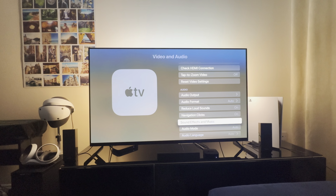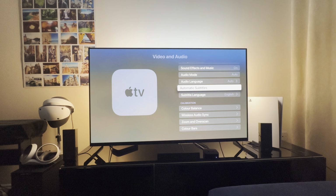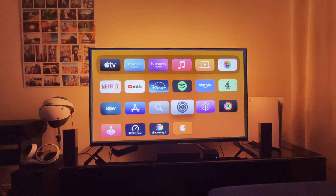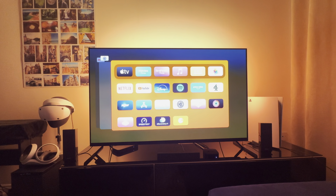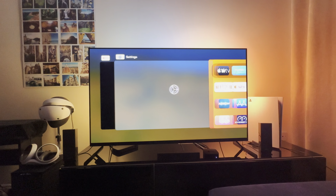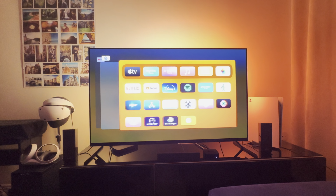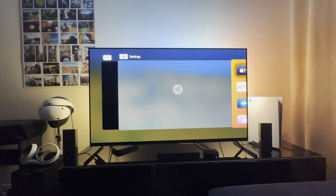Now, there are other light strips available on the market which claim to be compatible with HDMI 2.1, but when purchased, they do work with HDMI 2.1 devices, so technically it is compatible, but they don't work with full VRR pass-through on gaming consoles and don't allow 4K at 120 frames per second, but because they just plug in and work, they claim it's compatible. Now, compared to the competition, Philips Hue products are far superior.